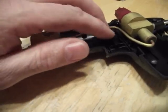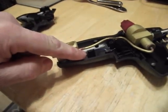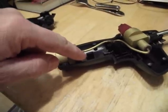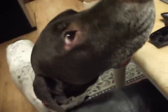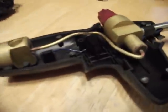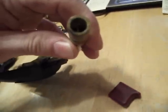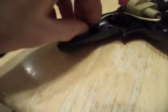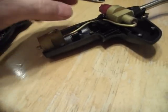And then, actually, these two wires actually don't connect. When you hit the trigger, a little tiny spark jumps between the two, and it seems like that spark makes the big spark jump up here inside the hole. And all I did was put those two wires back on there and it started sparking again.